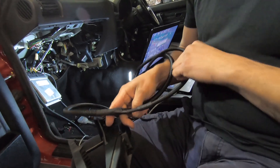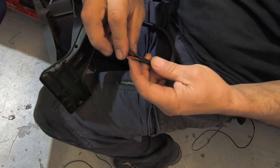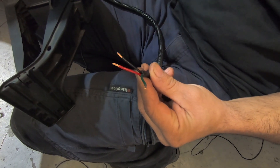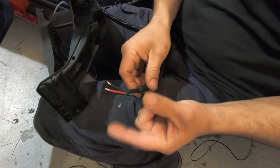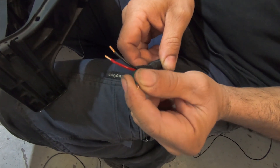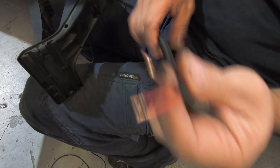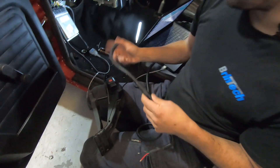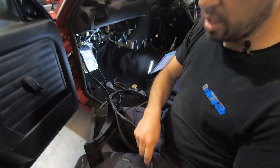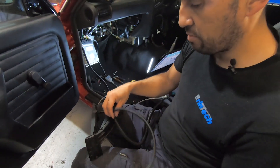I have also added this section here to this harness. These are three wires — we've got two wires here that are for the radiator outlet temp sensor. We've installed that already on the radiator. And this one here is going to be the PWM signal to the fan controller. I've just added it onto these harnesses to try and keep it all neat, and that's going to go through the firewall near the battery. Then I've got to make another section for the fan controller there, which will plug into that.